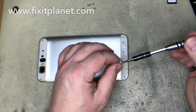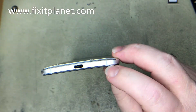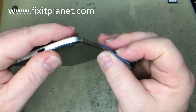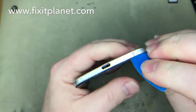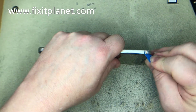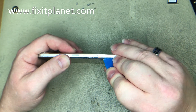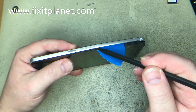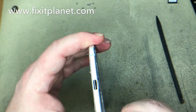Be careful that you don't damage the display when you're removing it. This one's banged up pretty bad so the frame's a little out of shape, which may have actually helped a little bit. This uses a USB-C dock, and stop short of the side buttons — you don't want to run your tool along there or you might break off some of those buttons, so stop short there.